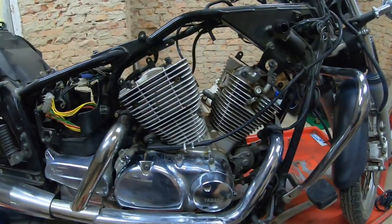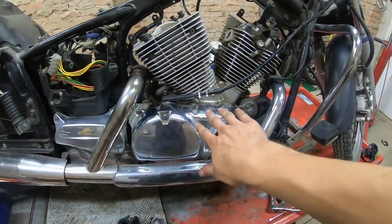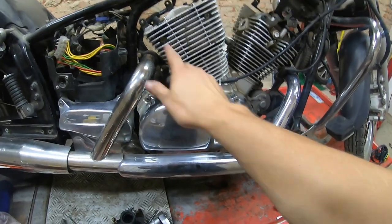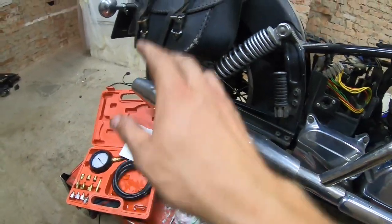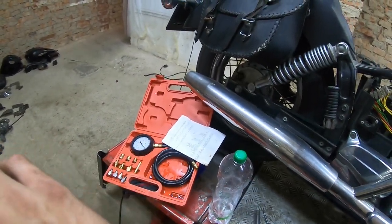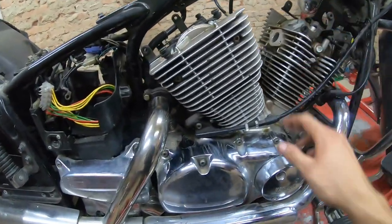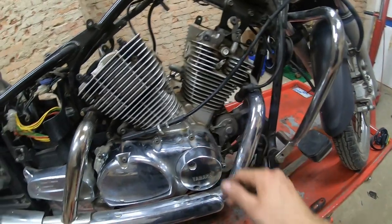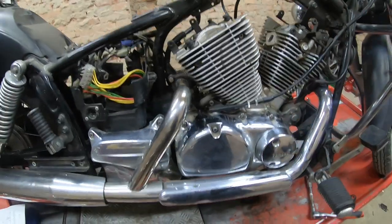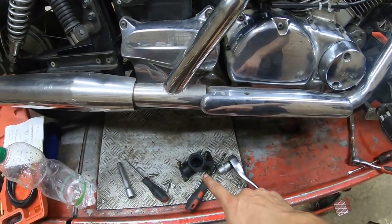So, quick summary, in the crankcase there was only gasoline, filled it up, check it for oil flow. We do not have a fitting, so we cannot check the pressure, but we can check the flow, which we did, and we squirted out most of the diluted oil out. I'm happy about it, we have flow. And we can start reassembling.